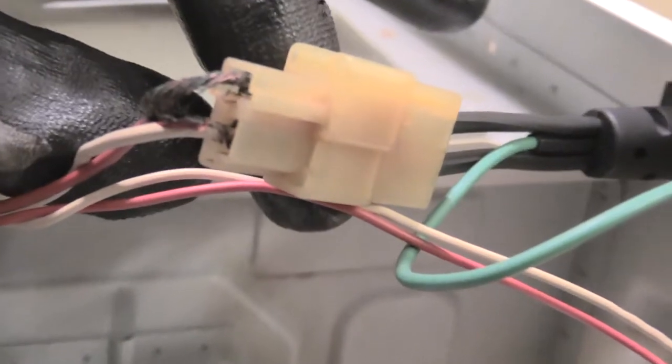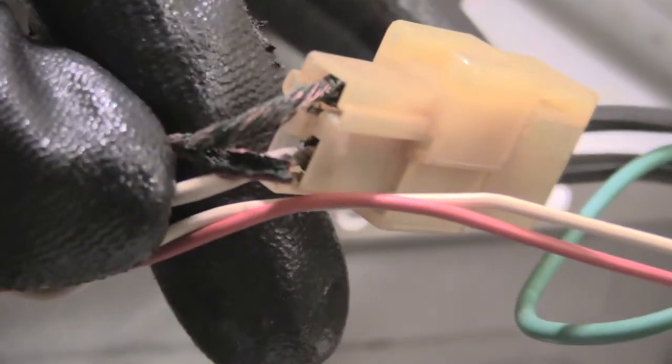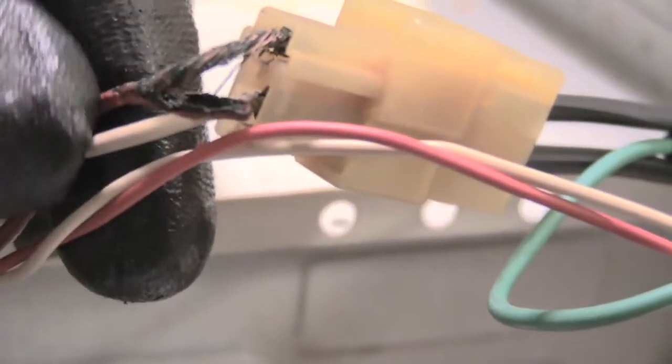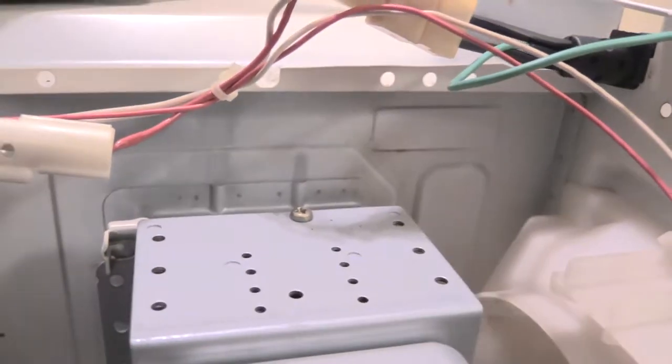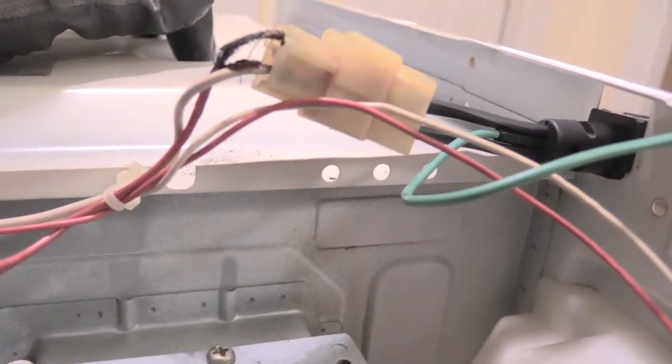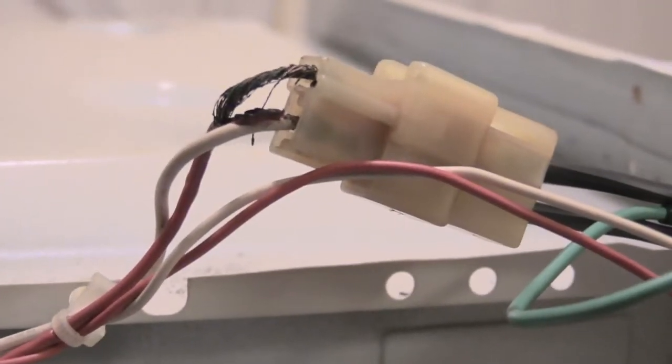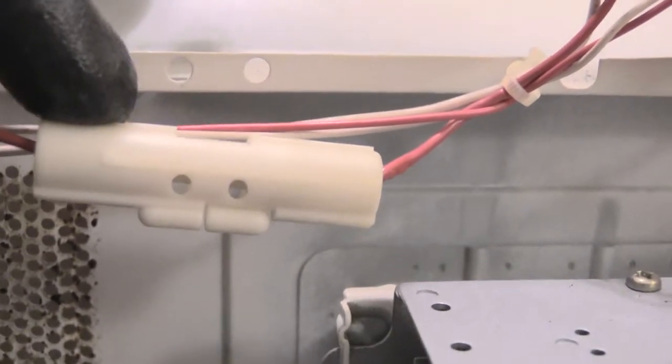If you look right up here, these are your actual electrical wires — the wire that you plug into the wall — and you can see right here this is all burnt and melted. This could have been a true fire hazard because it obviously caught fire at one point and burnt the rubber off around the wire itself, and that's what caused it to blow the breaker. I'm not exactly sure why this happened — it could have been a power surge. This piece right here is completely burnt up, so to fix this microwave you'll have to replace this wire.